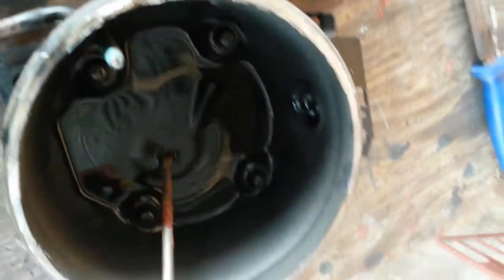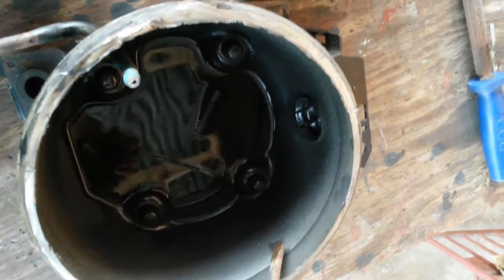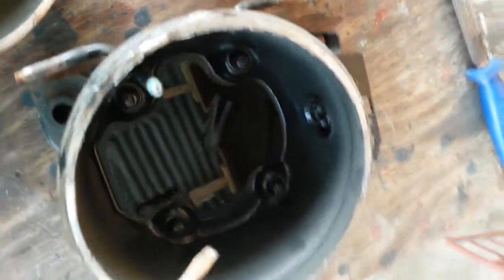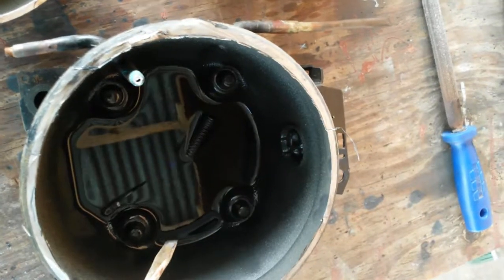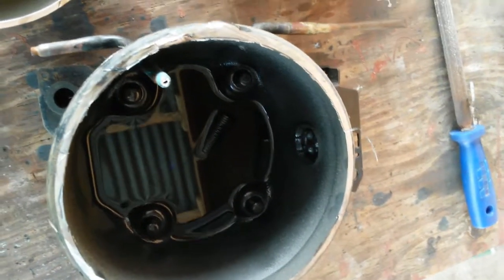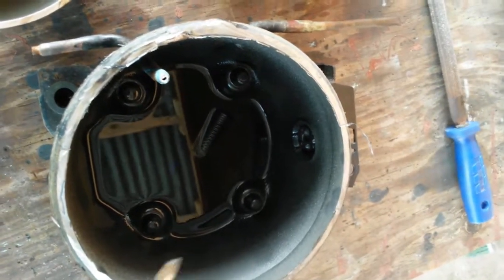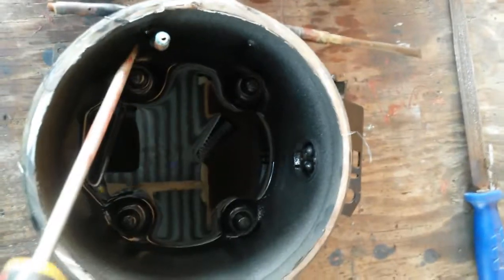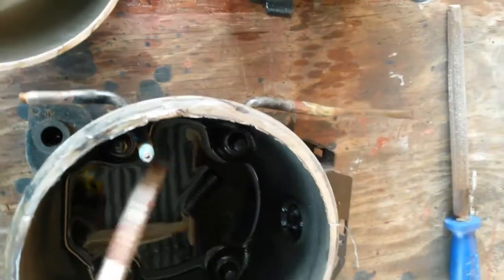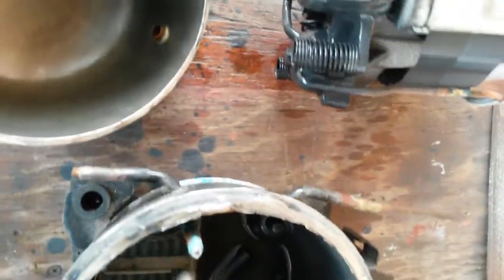The oil only looks dark — when it's dripping it's actually very light in color. I'll probably decant it into a container, but I don't think I have a use for it. Without understanding what kind of oil it is and how the refrigerant impacts its properties, and what remains in it, it may not be the best idea to reutilize it for anything beyond the most basic purposes. As expected, these connections are brazed in — there's one here, one here, and one here. Those are the three ports.